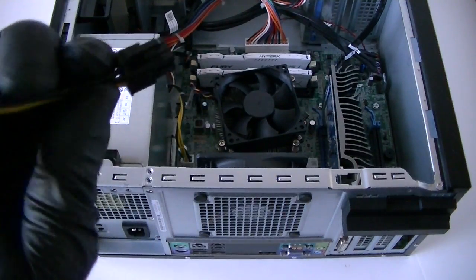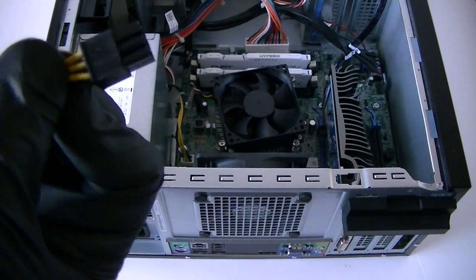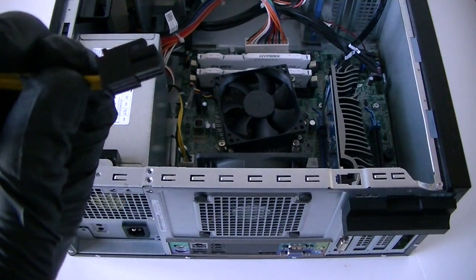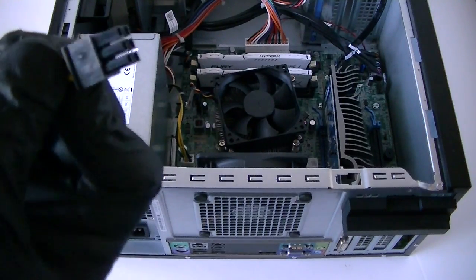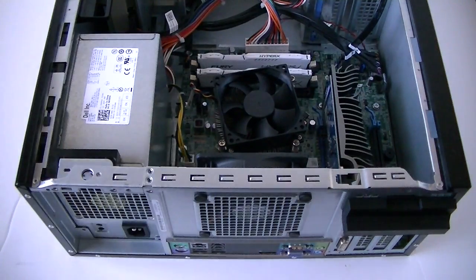So it's going to be good for like a GTX 950 — a GTX 750 will work fine — but something like a GTX 760, I know those require an 8-pin and a 6-pin, so you'd have to get a bigger power supply, at least like a 650 watt.